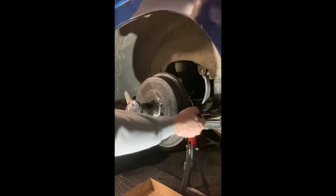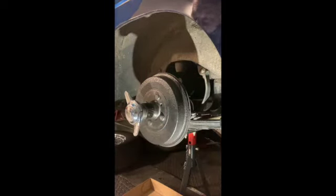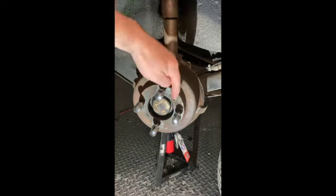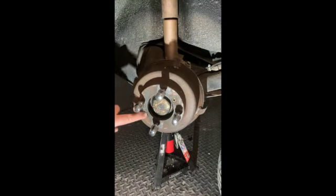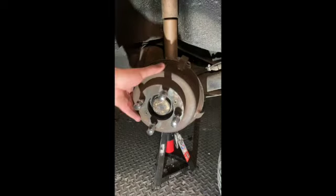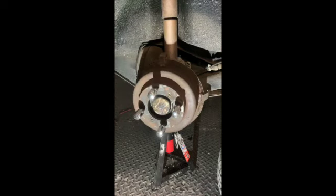You have the handbrake mechanism coming off the back here and going off round, obviously, to the handbrake lever. And over the top here, you have the little square screw set. And once I've taken off the front cover, you'll see how that all works. Just to show you on my Mini, here the Mini is with the 2 screws on the drum, as opposed to the 4 bolts that we saw for the wire wheel version. So this is the same fixing as you'd see in the metal wheel version.